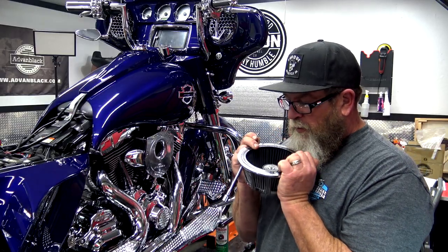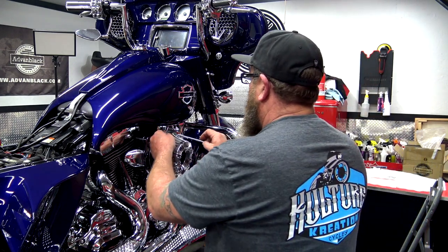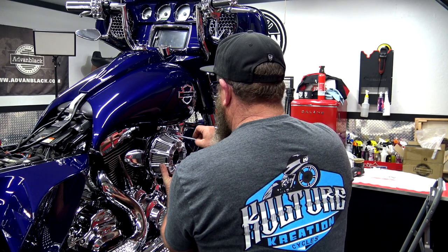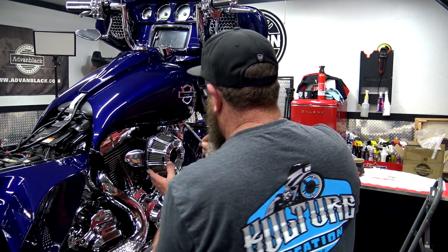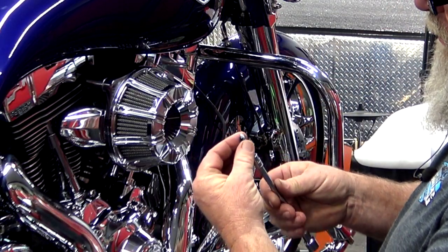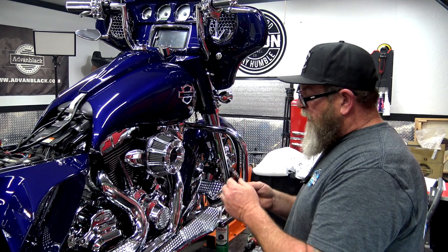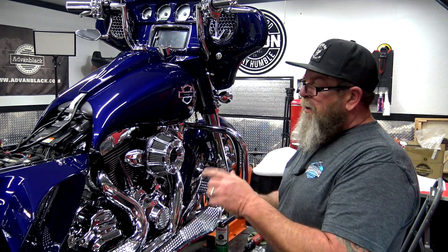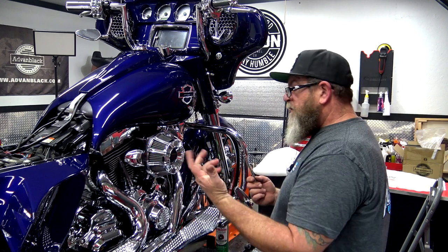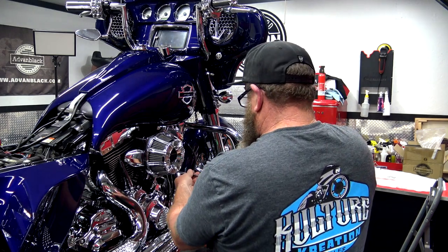Air filter all dried out, got it pushed back into our cover. Take one of our bolts, a little blue Loctite on there. We've got our banjo bolt covers — the things that fell earlier — we got those on there and we hope they stay while we put this in. Get that one not quite tight so I can still move this, but it's enough to hold my plate covers in. The reason I smear the blue Loctite around the bolt like that is because it gets so much on there going through a hole that it exactly fits in — if you've got a big glob you'll probably end up with a big glob of blue Loctite out here when you tighten it up. Just get it around the threads so it sets up overnight.